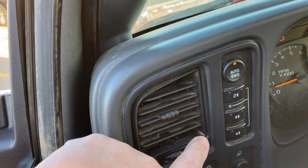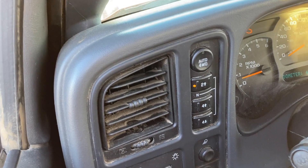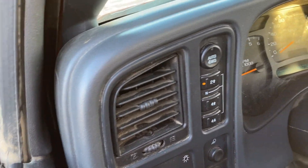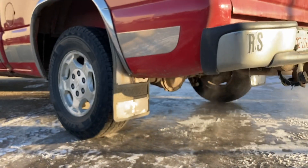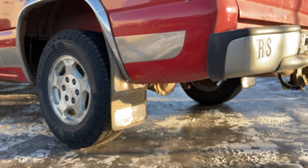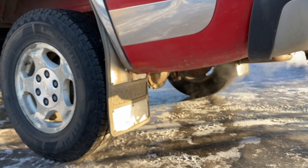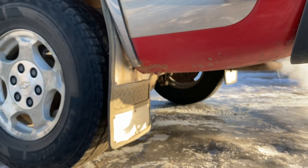So again, we're just going to put this into two-wheel drive. The truck's in just two-wheel drive. And when we move this into reverse, you'll see both wheels lock — the rear differential will automatically lock to give us the best possible traction. Give her a bit of gas. See, they're both spinning together. See, they're both spinning.